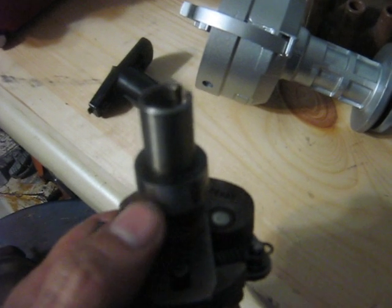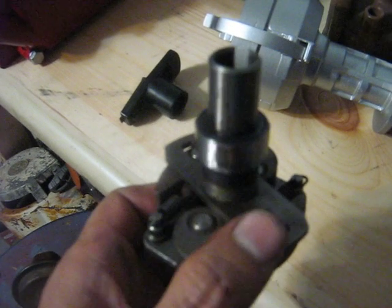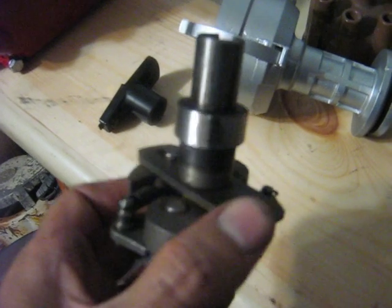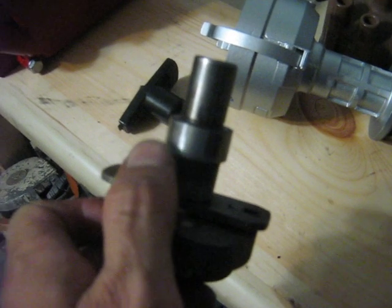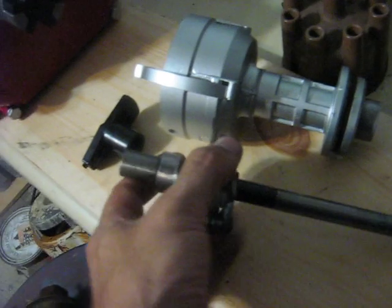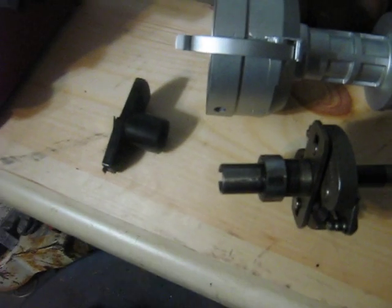The other thing, since this is an 8-cylinder distributor, this used to have 8 little ramps on it to open the breaker points up for 8 cylinders in one revolution of the distributor. So now I only needed 4, so I basically just ground 4 of the points back to the base circle diameter. So now it only has 4, so that it won't fire in between when there's a spark plug not there to take the electricity.